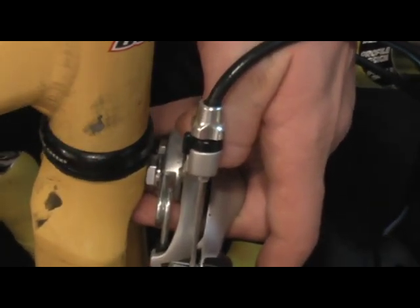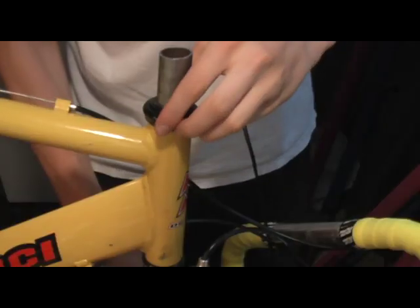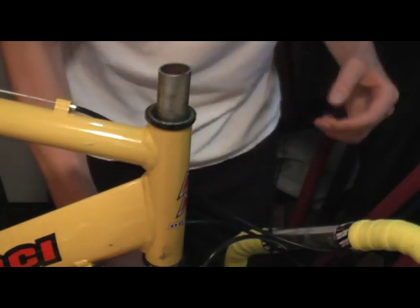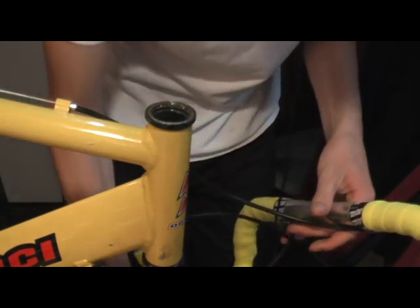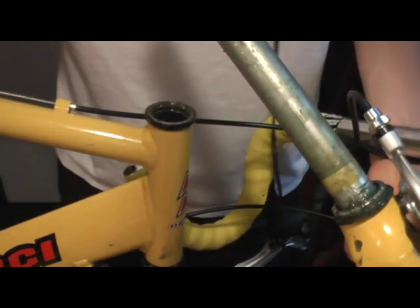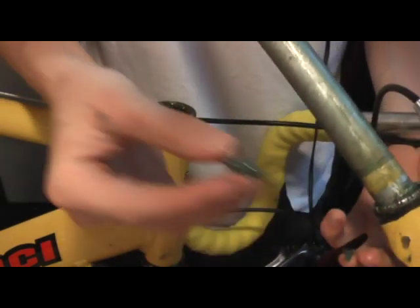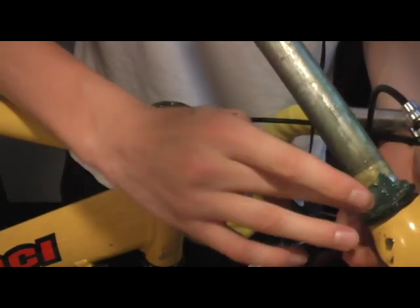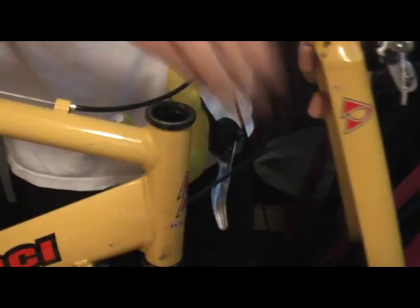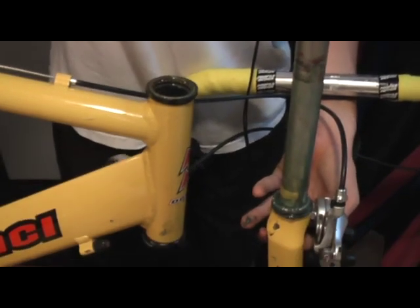What we're going to do is take all of this apart and grease up the ball bearings. Remove the top cap and slowly bring the steerer tube down out of the frame. This right here needs a substantial amount of greasing, especially the ball bearings — this is where all your turning motion is going and you put a lot of pressure on it. Keep the grease liberal, put a nice coating around the ball bearings. Once you've greased that, you can essentially just slide this back into the frame.